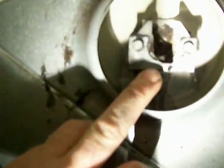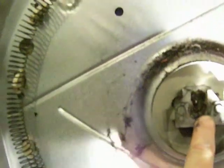You can see right. Hang on. Get the light on here. You see this hole's not worn very straight. So it needs an element and needs this. And I think because this dropped down, it cut the top side of the coil off, rubbing on it. And you'll probably see it. See the arc marks right here? That's what took it out. You see the burn marks on it there. That's what took the element out, because this thing here pooched it. Okay.